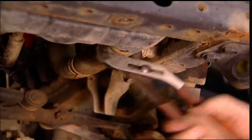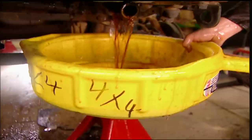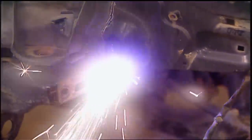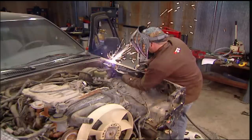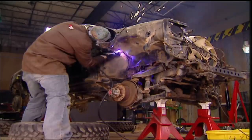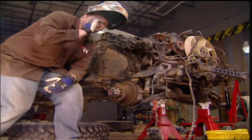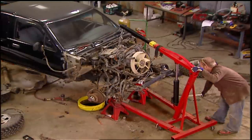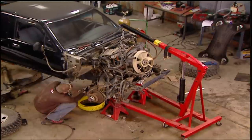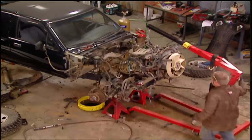This is a little overkill — we could honestly run this truck without narrowing the front end and most Toyota guys do. Getting all this sheet metal out of the way will help with the next few modifications. When this truck showed up, the motor was making some serious noise. The timing chain is broken, it will not start, and we really have no idea how much damage is done without completely tearing it apart.